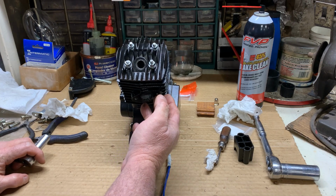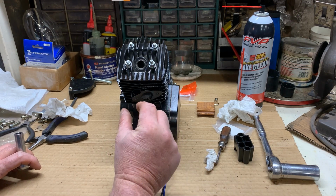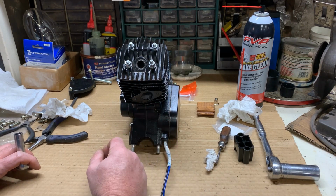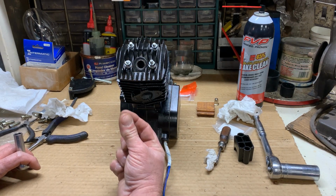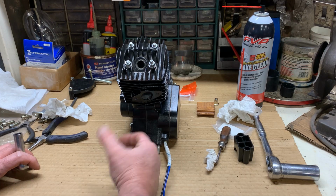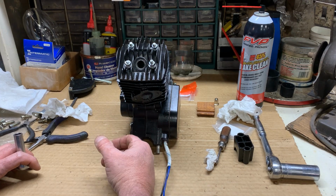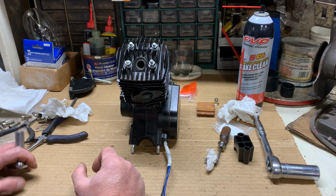The exhaust gasket is usually, after your first initial running, real thick and it heats up and shrinks. So that is why your exhaust will be loose right after your initial, probably second ride or whatnot. You'll notice when you put your wrench to it that you'll get an eighth or a quarter of a turn out of them. It's not from vibration, it's from the gasket getting hot and shrinking. And after you retorque your exhaust, usually you don't have to ever fool with it again. After the gasket shrinks once, it doesn't keep shrinking. It does it once, maybe twice at the most, if you didn't get it hot enough the first couple rides. And usually after that, you have no problems.